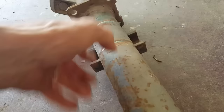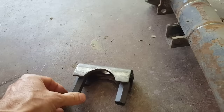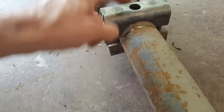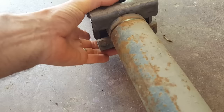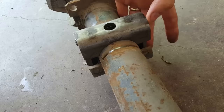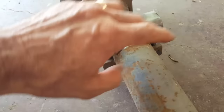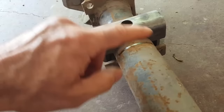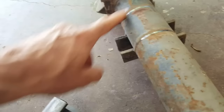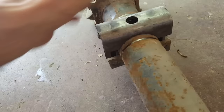You've got the old saddle and the new one with adjusting nuts. It goes on the axle and they want it tack welded in place. The new top pad needs to be exactly parallel to the existing pad — make sure the distances from edge to edge are exactly the same. You can adjust with the nuts; welding is recommended but not required. I'm going to weld mine on — I'll clean some bare metal and tack weld it in.